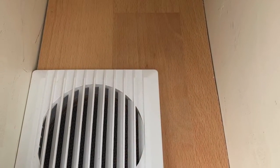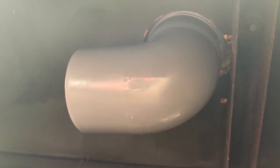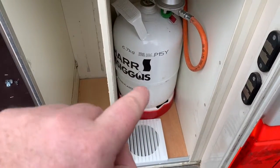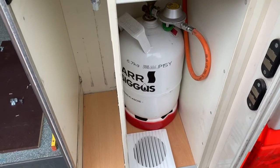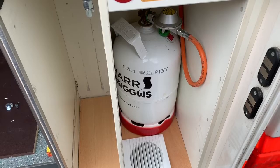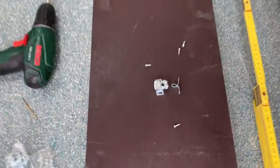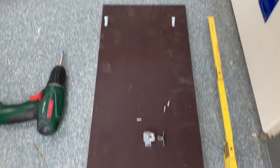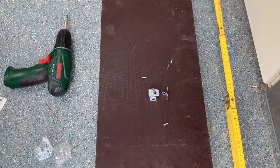You can see the laminate-lined gas compartment and in the following image the fan cover already inserted. To prevent moisture from entering from below, I also installed a bent 90-degree pipe. This is what the finished gas compartment looks like — lined with laminate, the edges sealed with beige silicone. You can see the exhaust vent grille for the forced ventilation. What is still missing is the lid for the gas compartment, which hermetically seals the interior so no gas can enter the living space. For this I'm using a birch-faced panel, which I intend to fasten at all four corners to the vehicle using furniture snap latches.